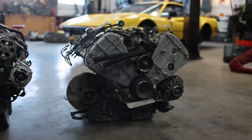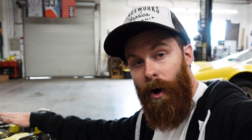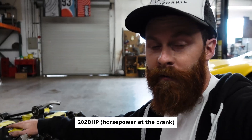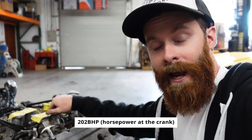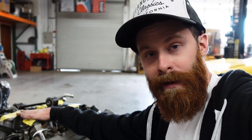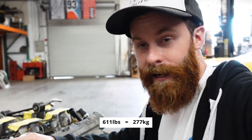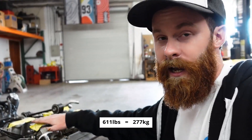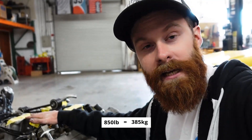Let's talk about the original numbers from the original Ferrari F106 V8. The F106 only sports 202 horsepower from the factory — I was wrong before when I said 205. It's 202 horsepower and 179 pound-feet of torque from a 2.9-liter V8 that weighs over 600 pounds. That's with the transaxle but without engine accessories; adding those in, we're talking over 850 pounds of drivetrain weight. It's completely ridiculous.